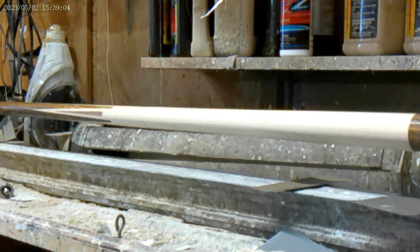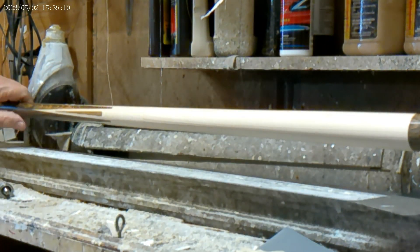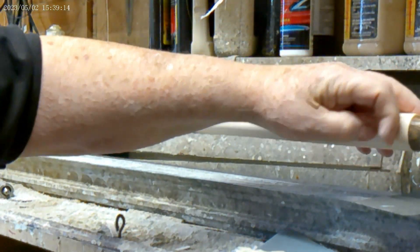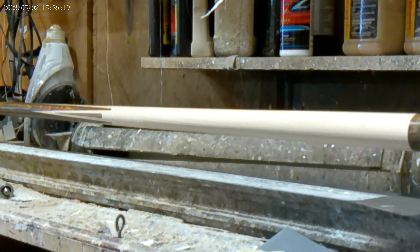Alright, I've got one of my Stinger jump breaks in here right now. I've been running it through my pole sander and it's got 1200 scratches on it right now. What I'm going to do is take and use the 1500 now and wet sand it with 1500 — that's where I need to be right now. So what I'll do is I'll prep it with 1500.